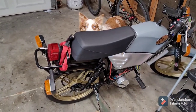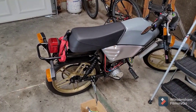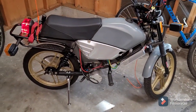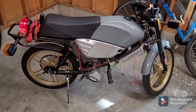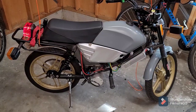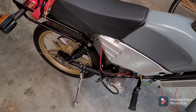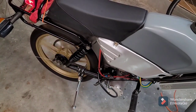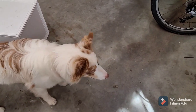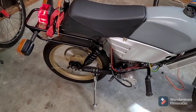I'm going to try to lift this bike up so we can see if it'll make that sound when it's not under load, just to show you what was happening. I'm going to test this motor to see if I can get it to make the sound when the rear wheel is hanging off the ground as opposed to when it's under load. My guess is it's not going to make the sound with no load, but it definitely does it when I'm riding. It doesn't make the sound when it's not under load. The chain needs to be adjusted.